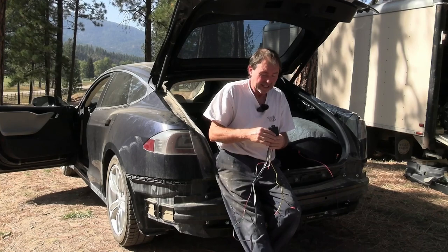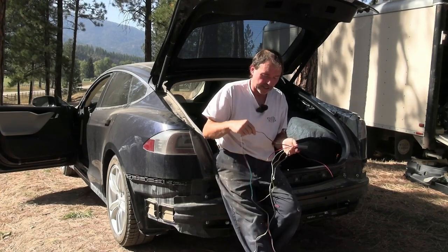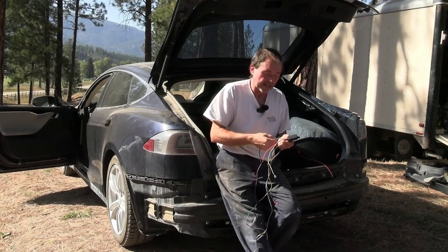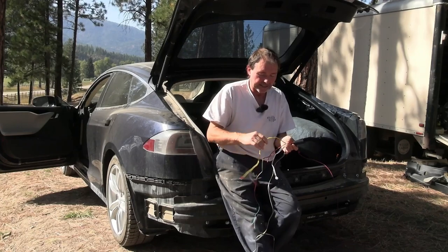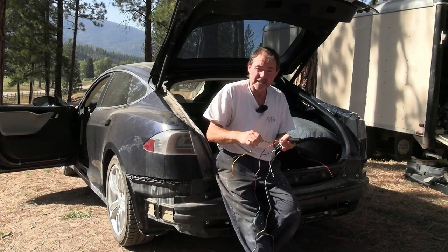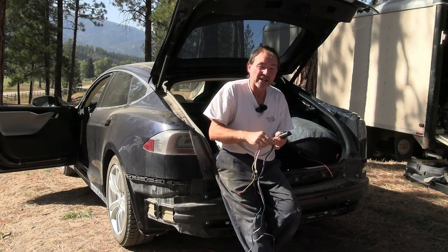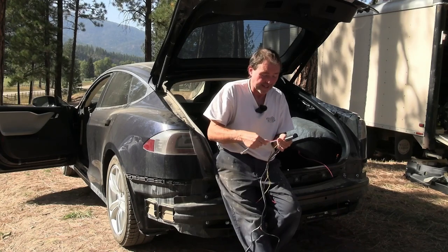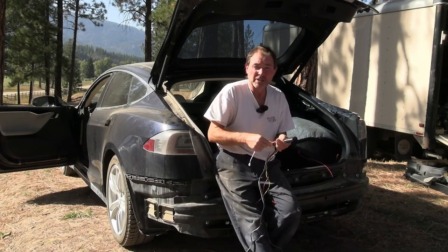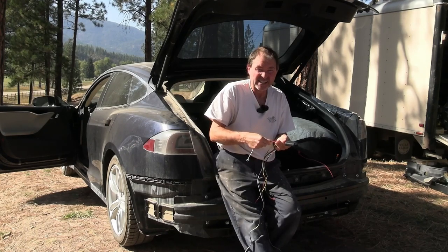So I hope you're not all confused about it. Main thing to remember, do not hook up the wire that is labeled brake. Don't need that. And do not hook up the wire that is labeled tail light to your tail lights back here. You need to have a source for the tail light that does not blink, that's not flashing, which I found to be the license plate lights. So now that's what I gotta do, and then I can test it again.